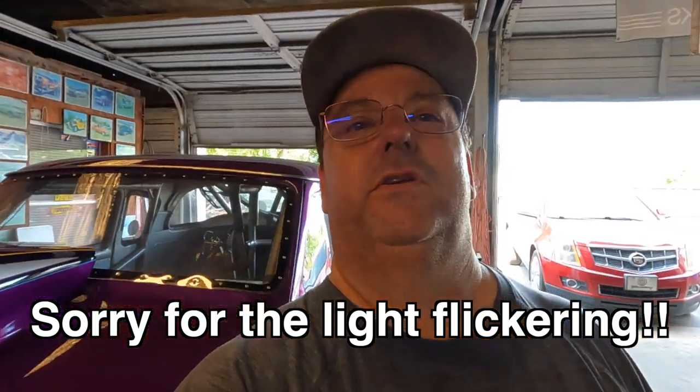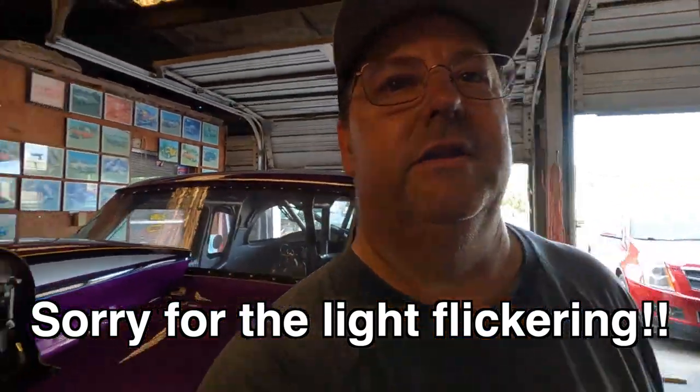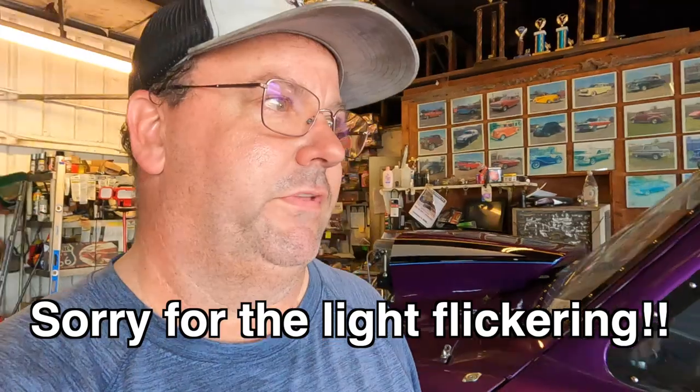We do have a preference that we generally try to run on these big tire cars. I generally like to have 50 to 70 pounds more on the left rear, and we usually run our anti-roll bar right at neutral, but the right rear anti-roll bar extended about a half a turn more than the left rear. That just helps account for the chassis twist — how the motor twists the chassis up over the right rear tire more.